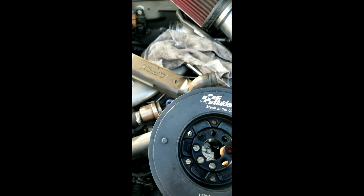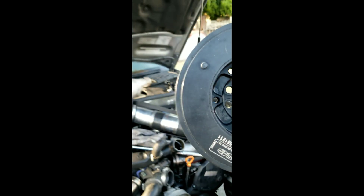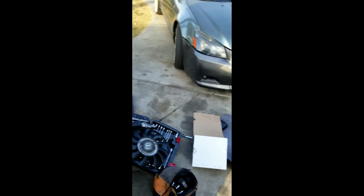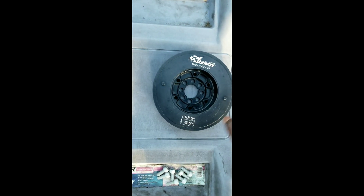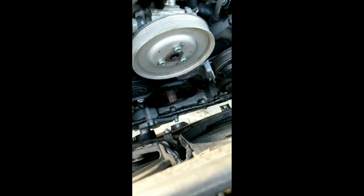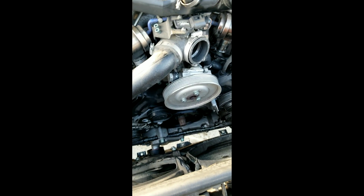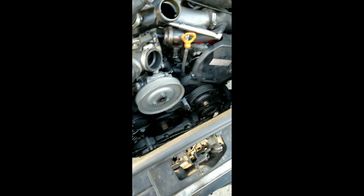This one is fluid-filled with silicone, so basically when the motor's spinning, that silicone is moving around, and when vibrations are happening, that silicone moves to the opposite side to cancel out those vibrations. The rubber ones are tuned to a certain RPM; this one is like infinite, so it's going to protect the engine through the whole RPM band. When you start upgrading your motor and putting a lot more horsepower to it, you want to upgrade your damper. Some people put the lightweight pulleys on — I've put them on some four-cylinder turbos without problems — but with this motor being a bigger V6 with a lot more horsepower, I went ahead and got the fluid damper.